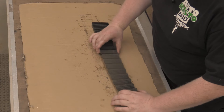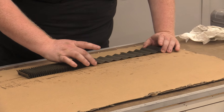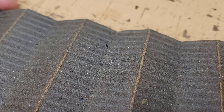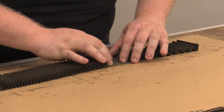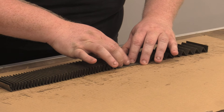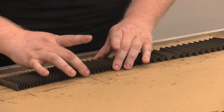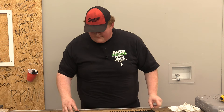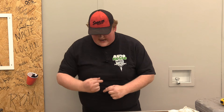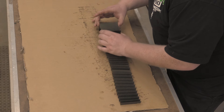I have the filter material cut out. I put it in a vise, squeezed it in a Ziploc bag to push all the oil out and make it easier to see. We do have some metal — a couple of flakes. All this stuff is really powdery. I would mostly attest this to flashing on the camshaft and lifters breaking in. There's nothing in here that's solid actual pieces of metal. You run your fingers over all of this and it turns to powder when you wipe it down. None of this I would be really concerned about — especially on a fresh rebuild.